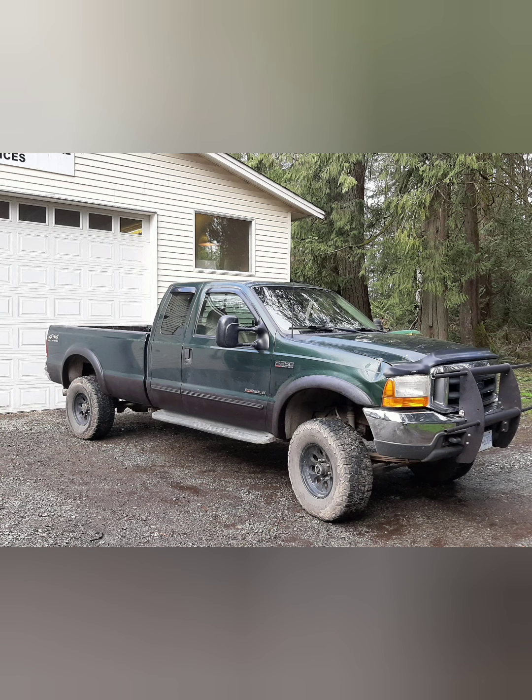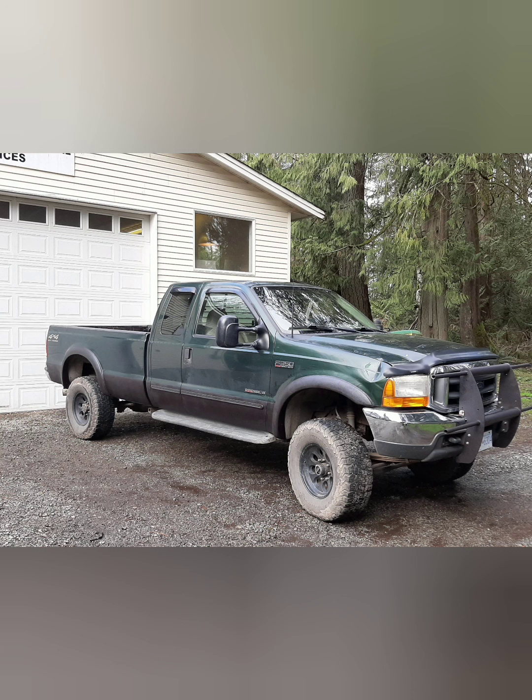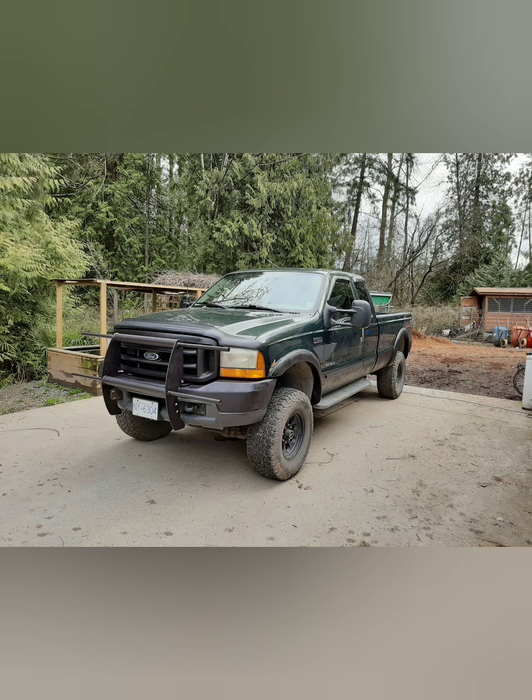With the idea of Raptor Lining my truck came a few other maintenance jobs that fit the opportunity perfectly. I replaced both fenders, as the passenger side had a massive dent and the driver's side had a rusting hole that was becoming too big to ignore. I also replaced the tailgate, which was in very poor condition. I greatly advise you to consider any bodywork that needs tending to before Raptor Lining, as it is easier to spray it in one time frame rather than small segments.